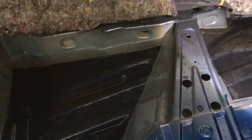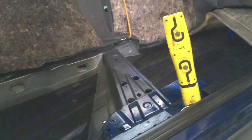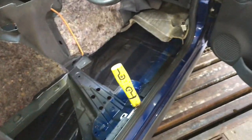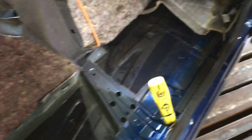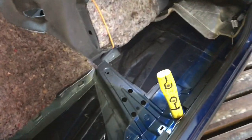Don't assume because the water's at the back that the leak is coming from the back. So we're going to get a suction machine. If you're doing this at home, this is how to do it: get the seat out. And if it's a passenger side, don't recommend turning the ignition on because most of the time you can take these things out and unplug the bottom of the seat and the car doesn't know the seat's out. So you don't have to get the airbag reprogrammed.